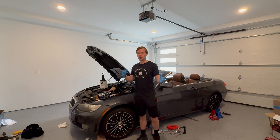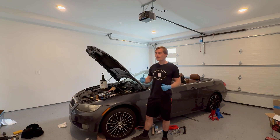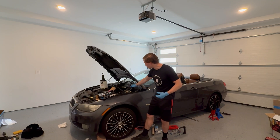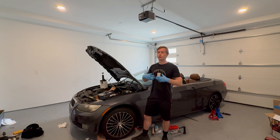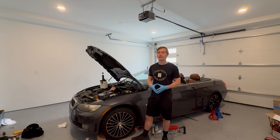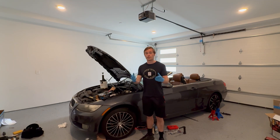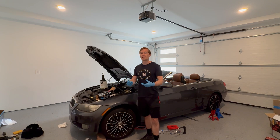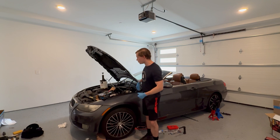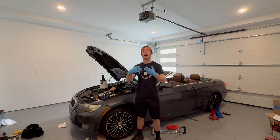In a general normal bleeding of a car, what we do is we probably use one of these pressure bleeders, or perhaps we do a two-man thing, and this is bleeding it from the top down. So basically, there's going to be pressure applied at the brake fluid reservoir or your clutch fluid reservoir on cars that don't have a combo fluid reservoir like on the E90. It's going to be applying pressure from the top of the system. Now remember, air likes to go up.